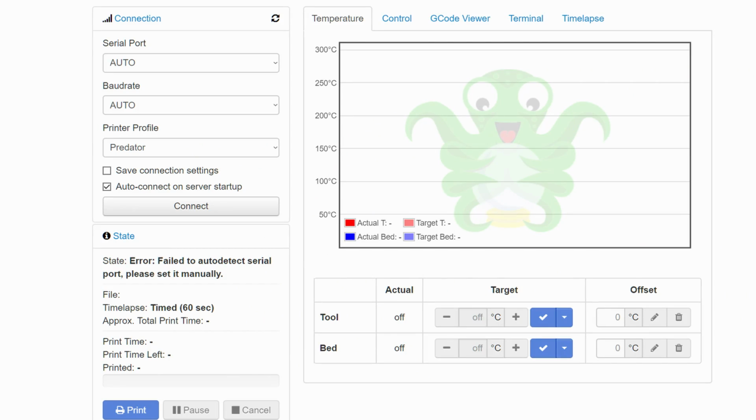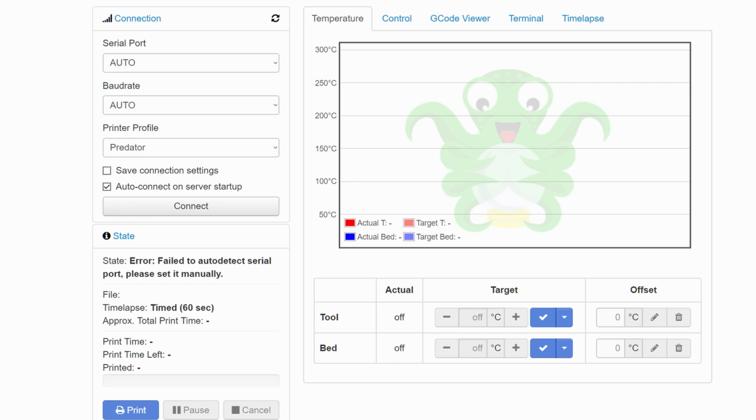This is something that you could get as an image that you download onto an SD card, and you put it into a Raspberry Pi. And then the Raspberry Pi acts as a print server, and it drives the printer. And what's nice about it is that the Pi has Wi-Fi. So I could send this part from my computer. I could just be sitting in bed with my laptop, and the part goes to the Raspberry Pi. Once it starts printing, I'm not connected to anything. It just runs from the Pi, and it basically gives the printer Wi-Fi without it having that feature naturally.